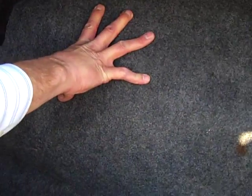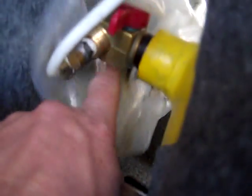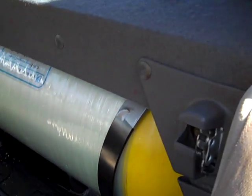Here's the tank. It's well secured in the back. We've got plate steel underneath and we used the existing carpet and just secured it above there so that it will stay in place really well, and it fits the vehicle just like it was made for. So the tank's obviously behind the carpet. And here's the valve. He's got three lines coming to it: a line feeding from the bottom going to the front of the vehicle, a line going to the fill nozzle, and then a pressure relief device as well. The pressure relief is coming out behind the fender shield and back toward the back of the vehicle.